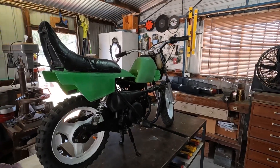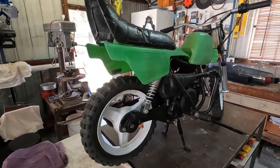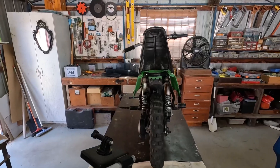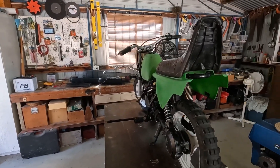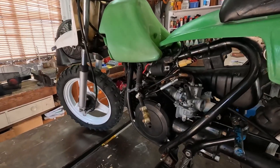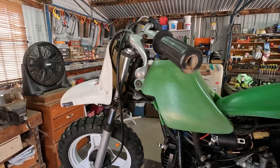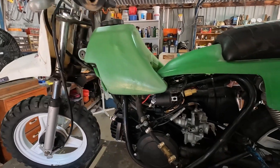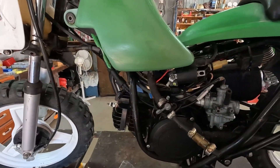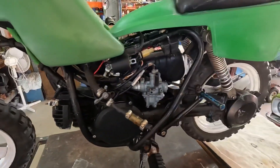There it is here. There's a few things missing off it. I've already noticed it's got a bent rim — the tyre sticks up a little bit, so we're going to need to replace the tyre. There's a couple of things happening down here that don't look real good. We're going to buy a few bits for it. Got the choke cable missing, needs a new carburetor, new spark module, probably a new spark plug. The actual lead doesn't look real good either.